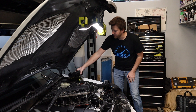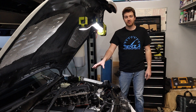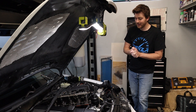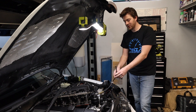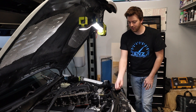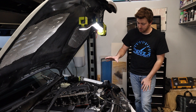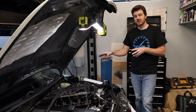I wasn't going to — and you don't have to, we talked about this in the unboxing video — you do not have to take the original CCV system out of your car. You can basically just tap into this and then plug your dipstick tube. Unfortunately something has pushed my hand to have to take the intake off. This line right here, which goes to the fuel regulator, slipped off the connector that's underneath the intake, and it's right in the middle of the intake, so it had to come off. While I've got it all apart, I'm going to be removing the CCV system.